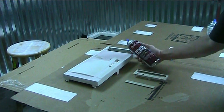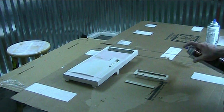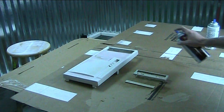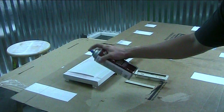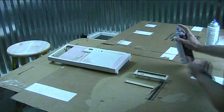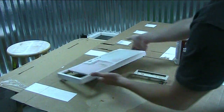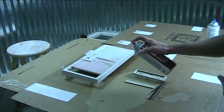Welcome back. Now we're ready to start laying down our color. I'm going to start off the front panel since it's mostly plastic and nice and smooth, now with some adhesion promoter. You can get this at any auto parts store and usually the best thing to do is use the same brand of paint that you're actually going to use. All I do is lay down a very light coat of adhesion promoter on top of the plastic that's been sanded smooth.